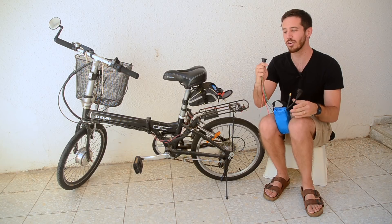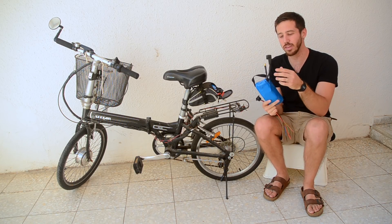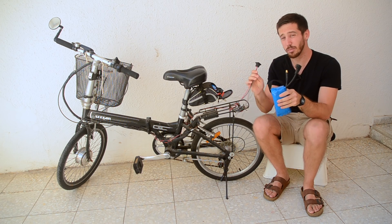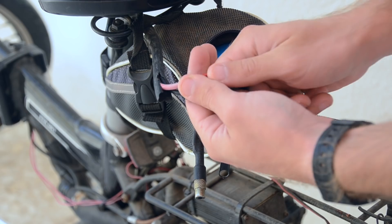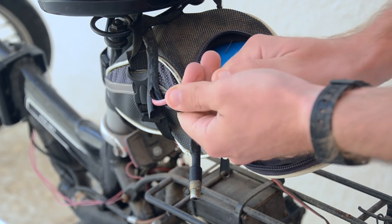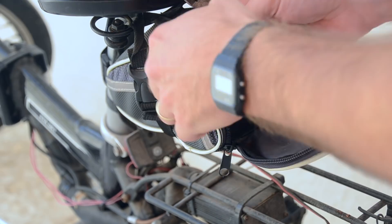So today I'm going to install this side of the magnetic connector on her bike. I already put the battery side on here, and I'm going to show you guys how I do that. Now I'll start by disconnecting my battery wires and then getting rid of the battery. You don't want to work on your battery wires while there's a battery connected.